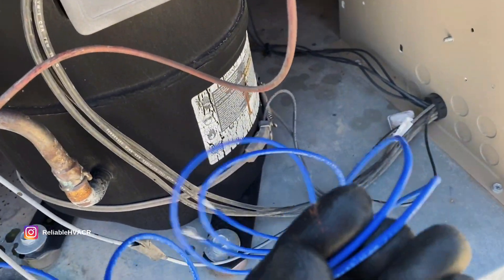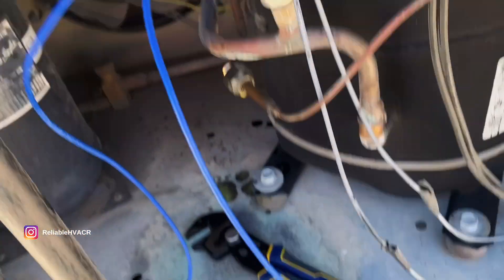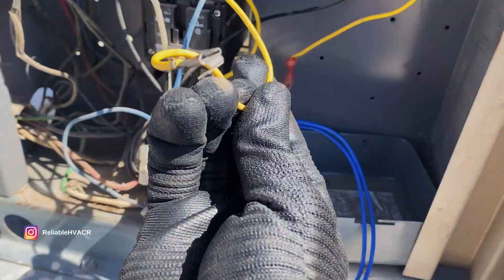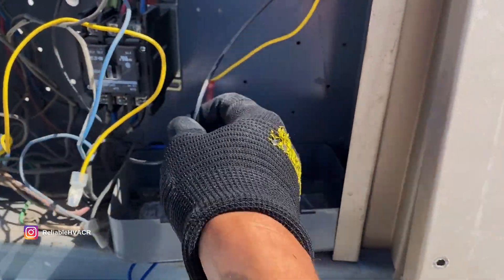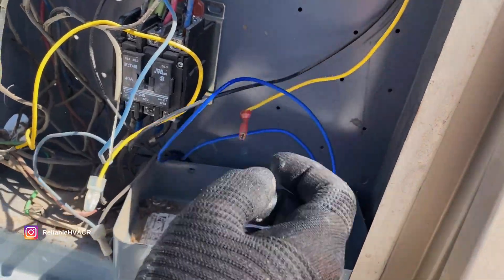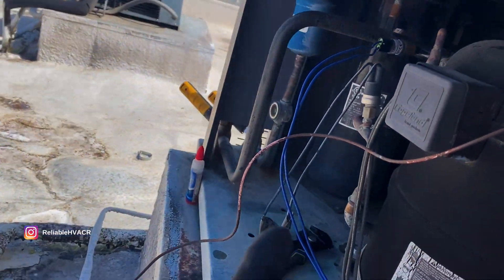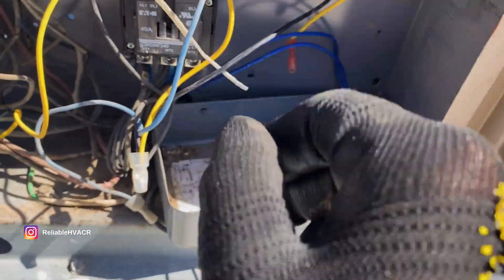Installed — easy. Now I can just wire it up where it was. This one cuts out at 10, so we'll test that out. Run it a little bit, run a defrost, all that. I remembered to turn off power — I almost shocked the crap out of myself. So we got one lead that went here, and I got to crimp that down because it's super loose. That goes on L1 basically, and the other one I'm going to tie into here — just going to cut it, splice it, and tie one blue there and one blue to where the yellow went. This wire is going to go through and is already going to be strapped over here. It's basically in series with the other pressure controls, so there's nothing I can undo — I just have to cut and wire it up here.